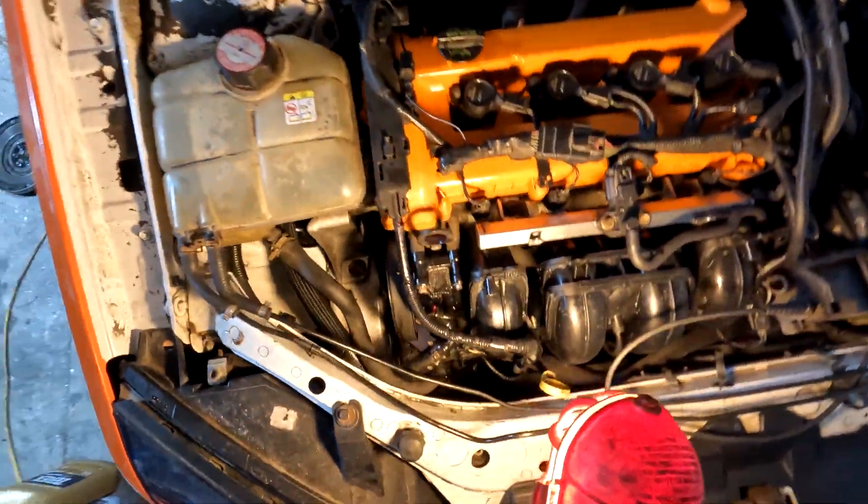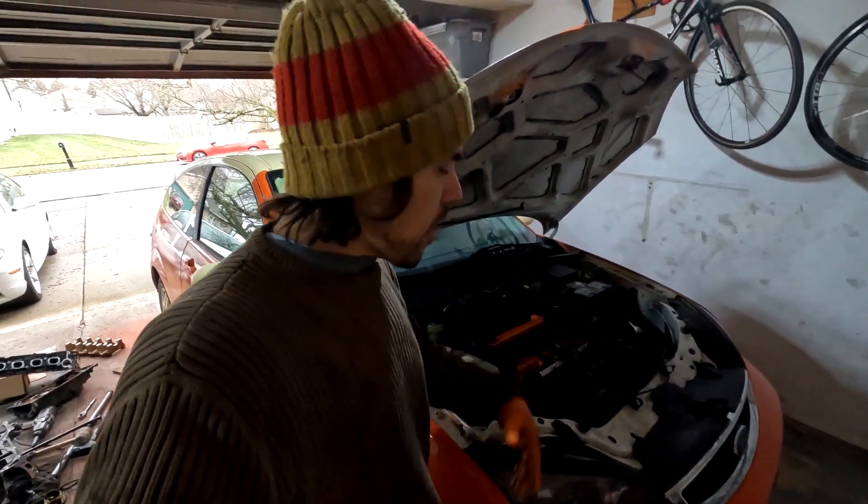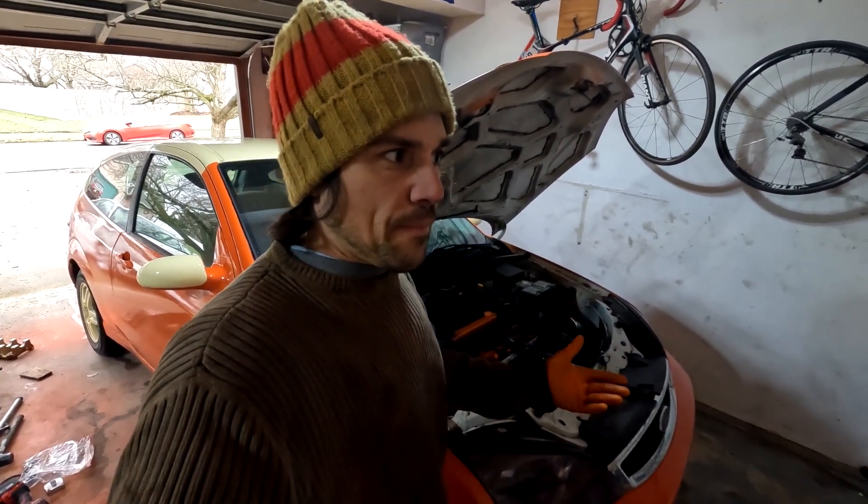We are just above full. We're going to run the car a minute with the cap off so the fluid can run in to replace any air bubbles. It's running good, not making any funny sounds. I did add another four or five ounces of fluid — I don't see any leaks, so I think we're good. I'm going to run it for a bit, pump up the reservoir to refill it, do that two or three times. That way about 90-95% of the fluid will be good — almost as good as flushing the system. It was only $42 on Amazon, should take you about an hour — probably less — and save maybe $200 at the shop. So if you're thinking about doing it yourself, go for it.